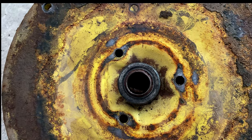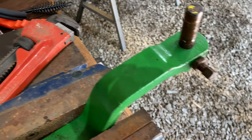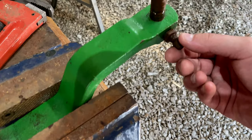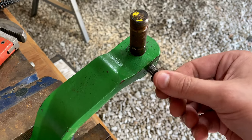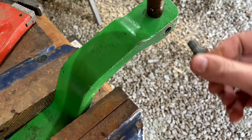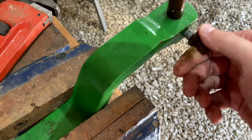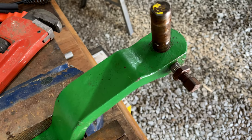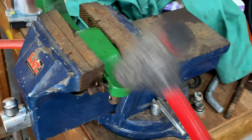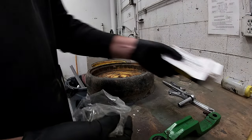We should be back in business soon. I put this in the vise and used a pipe wrench because one of my workers ran off with my larger crescent wrench — the pipe wrench worked great. It took a lot of muscle to get this off, it was pretty tight. You probably don't even have to take it all the way out because all it does is push into this groove — you'll see a groove on here. It's pretty seized up so I'll have to put the pipe wrench on there and work it out. We'll put this in the vise and smack it down through. There's the part number of the bearing.